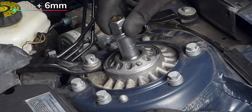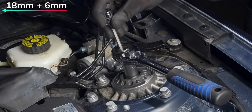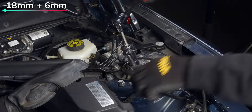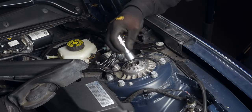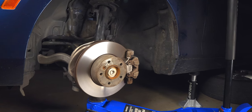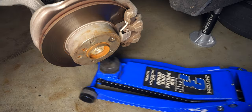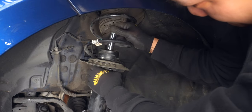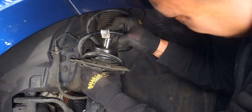The trick that we're utilizing to separate the OEM components works better the more worn out the suspension on the car is. Newer suspension may actually need a spring compressor if you intend to reuse the top hat. However, if you plan on getting camber plates as we did on the M235i, then you won't need a spring compressor either. It might just be a little bit more challenging to separate the strut from the knuckle as you'll have to do it in the wheel well.